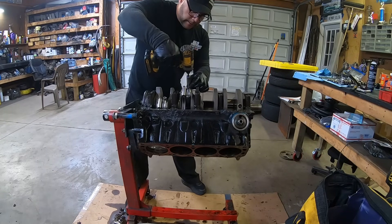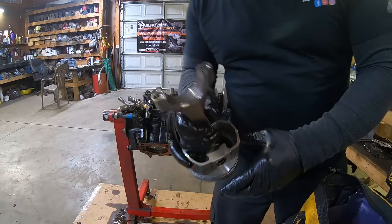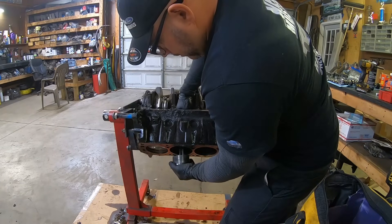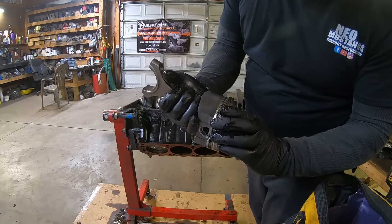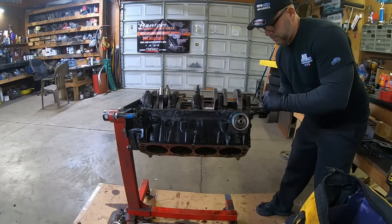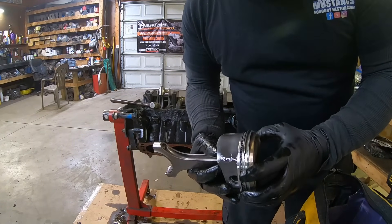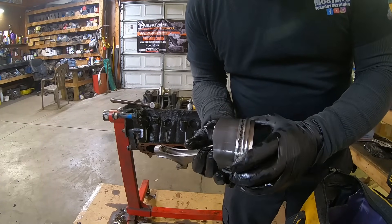Number three right now - here's number three's bearing, really good shape. Top bearing, rings look good, a little bit tight there. Here's number seven's bottom bearing - number seven looks good, rings look good. Cleanest engine I've ever seen. Number four's bottom bearing - here's number four's top bearing. This one had a little bit of skirt wear, it's not terrible - looks like something ran through it. Rings look pretty good, not cracked.